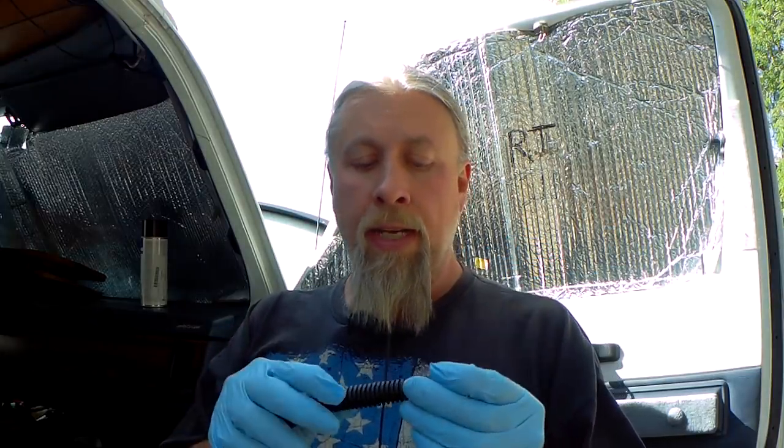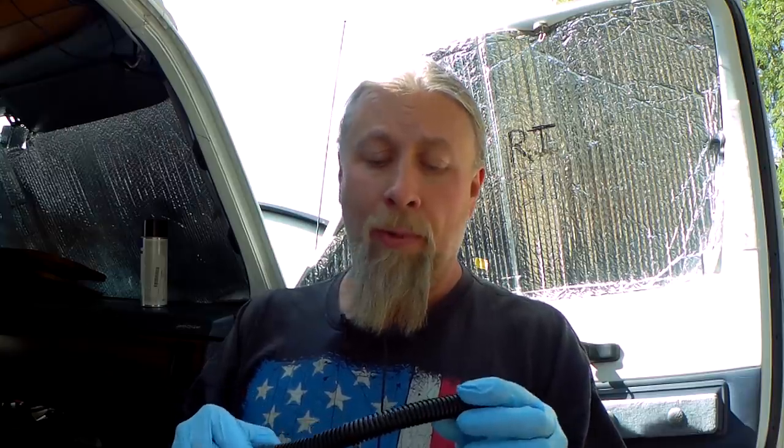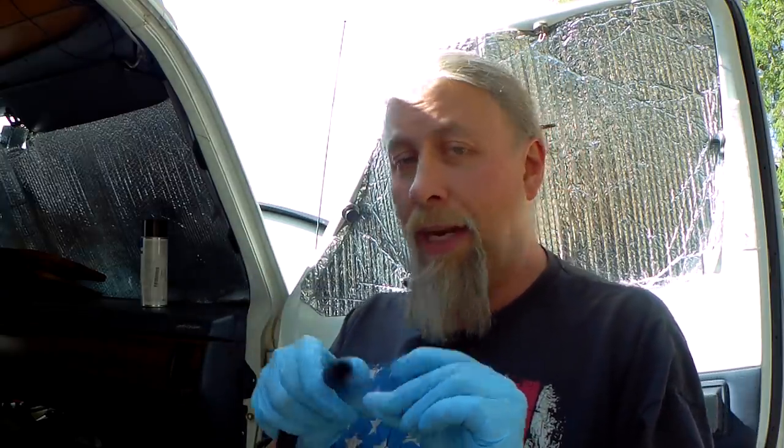People forget that I have a doghouse. I don't have a regular truck like a pickup truck where you can just open the hood and there's your engine. It just takes a lot more effort to get to. So my idea is just going to be to use the split tubing, put it over the wires, and it's big enough that it makes it more difficult for the mice to chew through. I know that this isn't a solution that's going to completely stop rodents from chewing up my wires, but putting this big honking piece of plastic around my wires certainly will slow them down.